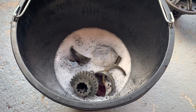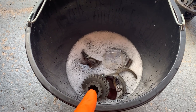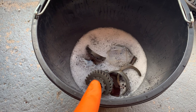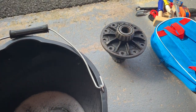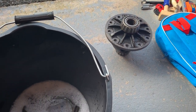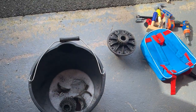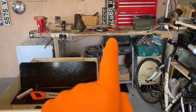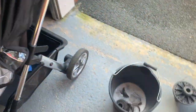I have quite a few of the smaller pieces in here, and the eagle-eyed among you will spot that the top gear is not out of a differential - that is the rear gear out of the back of the gearbox. You take that off to put the overdrive in, but it's greasy and sitting on a bench so I might as well clean it while I have the degreaser out. The carrier for the pinion is sitting there. I haven't taken the spider gears out, just trying to minimise the number of parts for now. The last bit to do will be the housing - the crown wheel still has to be done and the pinion, but the housing is going to be the dirtiest and will contaminate the degreaser the most, so it's best to leave it to last.